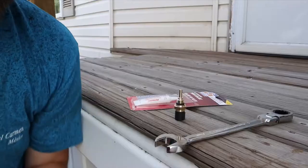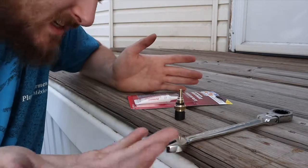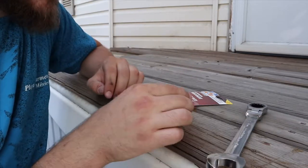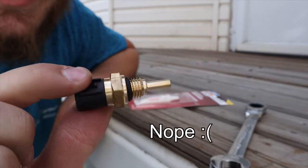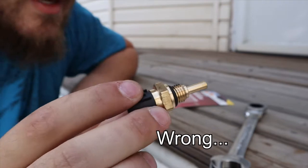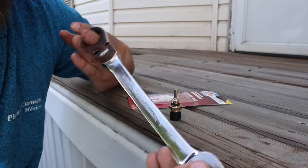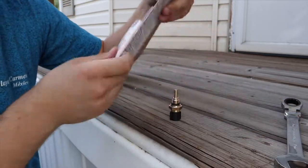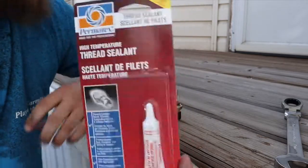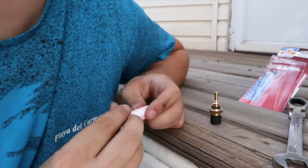So what we're doing now — we have our new switches, we're just gonna be using this one today. This is what you're gonna need for this job: a temperature sensor, which is the sending unit to the heat gauge on the dash. My old one was busted so I wasn't getting a reading before. We got a new one. We also have a 19mm swivel-headed ratcheting wrench, which just makes life easier, and high-temp thread sealant.